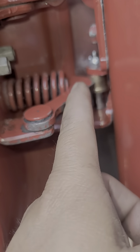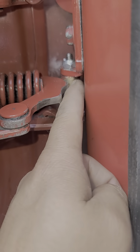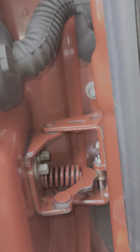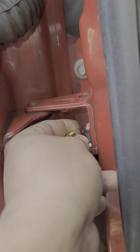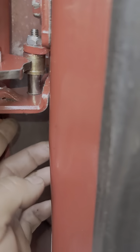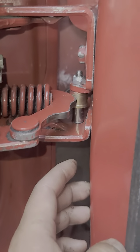Make sure that your door hinge piece is on that side because it can't come to this side while you're doing it. Just use your 11 millimeter with an extension going through here — put your 11 millimeter, your extension, and just drive it through. Once you've got that on, go ahead and grease your fitting and then install everything in the reverse order.